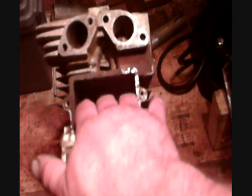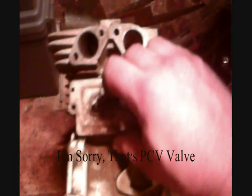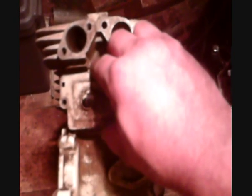At the point where the oil-soaked air is lubricating the valve train, it now needs to exit the engine and return into the engine — that's where the PCV valve comes into play. When this gets overworked, that's when it starts squirting oil out of it and starts creating mayhem. I'm going to show you how to modify this part to where that doesn't happen.